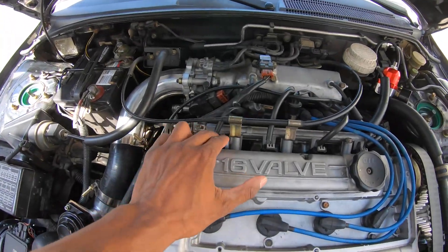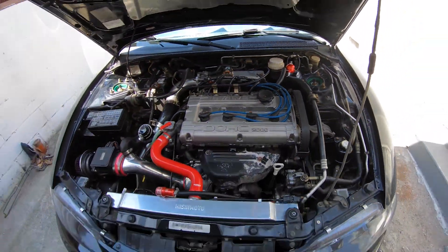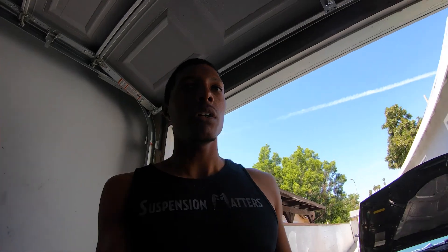Just got off the phone with the tuner — we reset the fuel trims, set the new injector sizes. Basically I could run E85 the next time my tank is empty: just stop at the E85 pump, fill up, change one setting in the fuel tab, and the car should run fine.